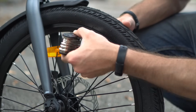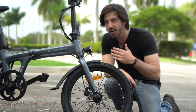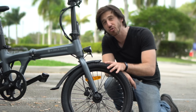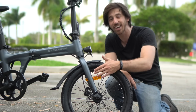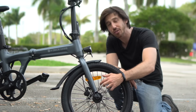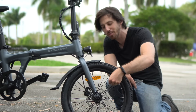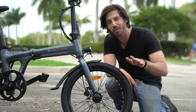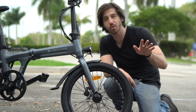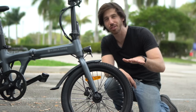In this case the multi-tool fits — it says it's a 14 gauge, so let's try that out — and we do fit, perfect. Now you do need to be careful messing with your spokes. If you don't know what you're doing and you over-tighten or over-loosen them, you'll get your wheel out of true. All you want to do is tighten a loose spoke just enough so it's tight again at a similar tension. You can even do the guitar method and pluck the spokes — you'll hear a little ding like a guitar string — and match that tension. I did a whole video on truing wheels; I'll put a link up here if you want to get into that, as it's a little more than beginner maintenance.